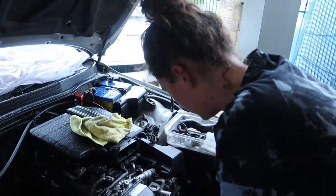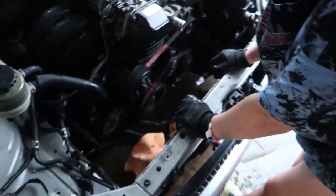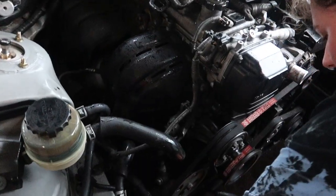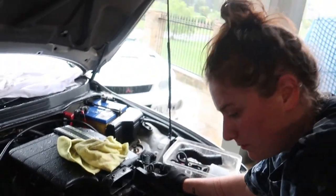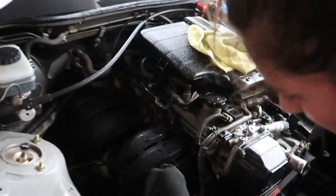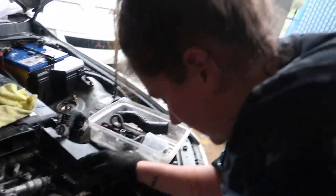That smells. Okay. You're gonna need to take off these two hoses from either end, it doesn't matter. You're gonna have to plug them back onto your new radiator. You've got this clip, this clip, and plugs. Then this plug, and then there's a hose that runs from the bottom of the radiator into here. Water hose, and water pump. And then, obviously, here to here.